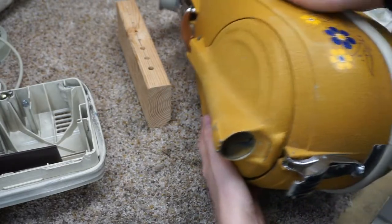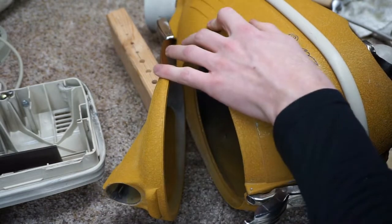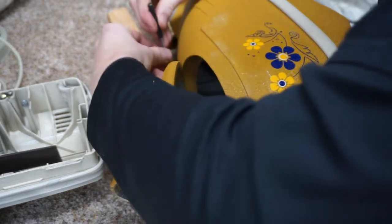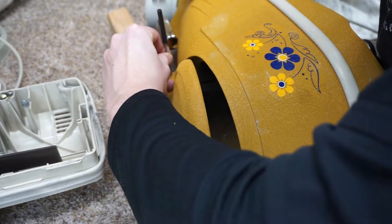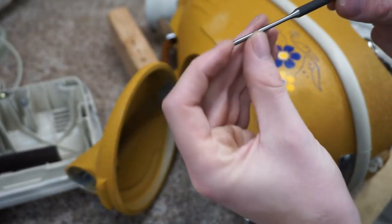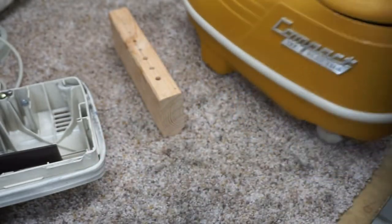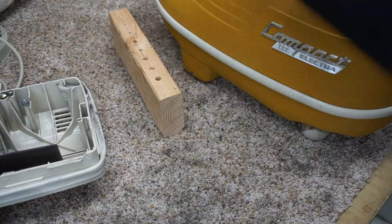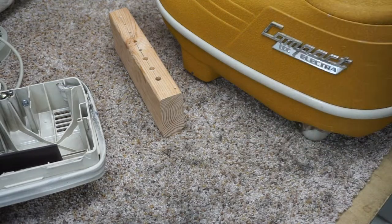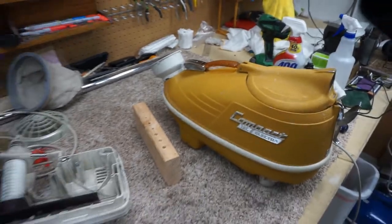So we're mostly through. There's actually a part that's sticking through now, and you can feel it there. There we go. So now we can get a couple of nice taps right there. If you're not familiar with this kind of punch, going back to gunsmithing, it's a roll punch. So the tip's rounded, it's nice, it's not going to hurt the paint. When it goes in, it's tapered perfectly. In fact, I punched that in just a little bit too far on this side, so we're just going to give it a little tap so it's centered. Perfect. And because that's still going into aluminum, that's what holds it in there with that burr. So we're not too concerned about that.